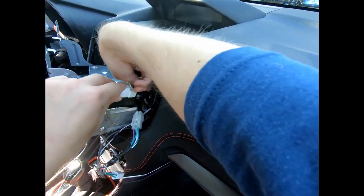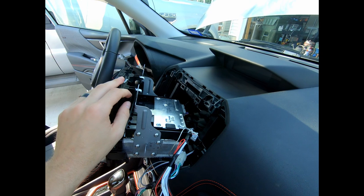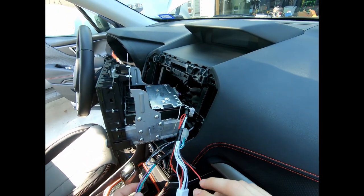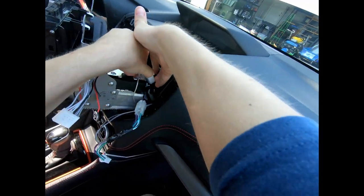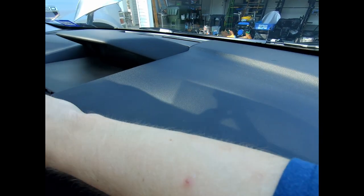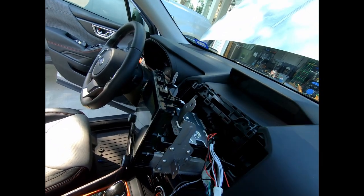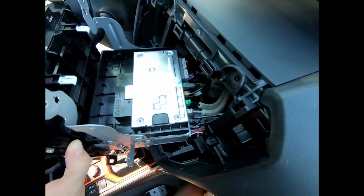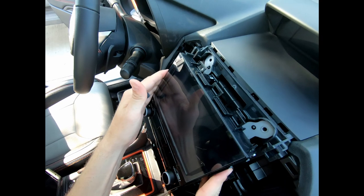These harnesses I bought are meant to plug into an amplifier so you can amp the sub and stuff — that's why there's a bunch of extra wires. I just didn't want to deal with an amplifier. Now that I've got these plugged in, make sure they're fully plugged in so the connections all work. I'll plug these back into the back of the head unit. I'm not going to close everything up yet because I want to test with the sub first before sealing everything. I've got everything plugged back into the back of the harness with my new jumper harnesses, and I can just kind of set this back for now.